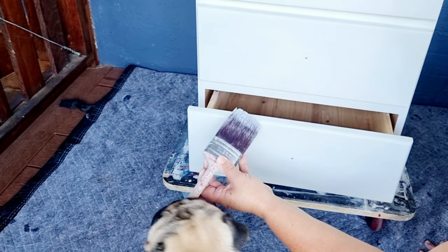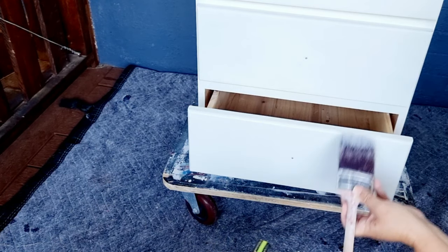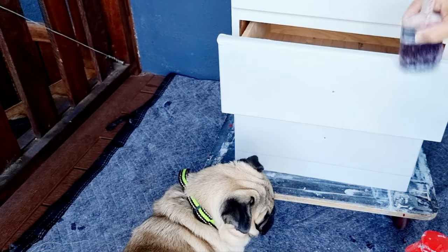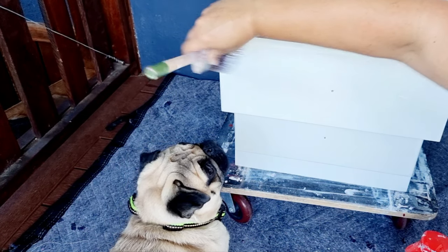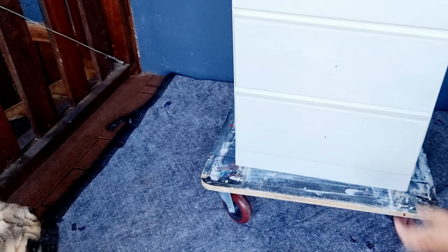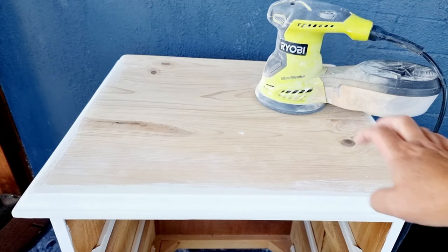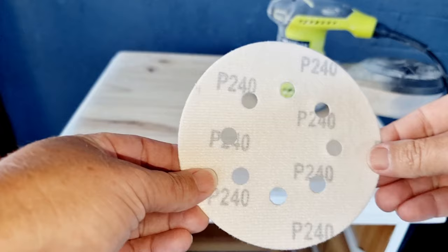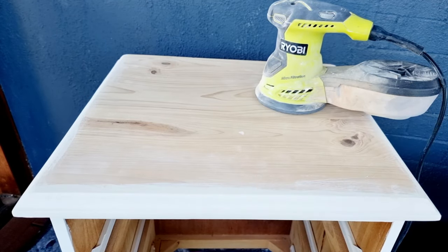Here I am teaching Frank how to paint and he's just doing it a bit heavy. Now we have painted the body - it's time to move on. As you can see, all this paint that's overlapped here, I'm going to use 240 grit. This will give me the final sand for the top of this piece and also take off that excess paint. Now we've sanded that, grab a microfiber cloth and make sure all that dust is off.